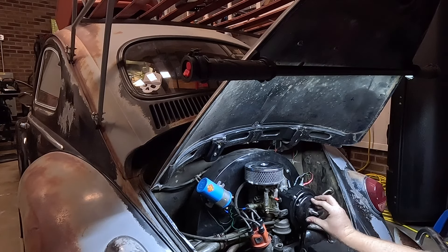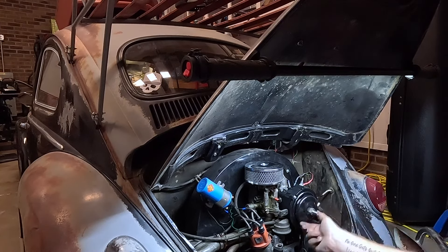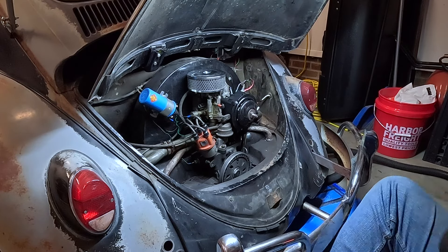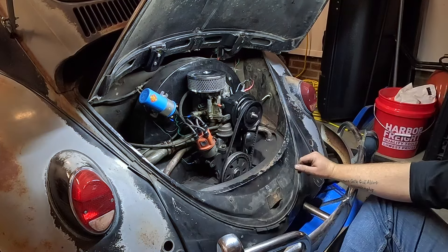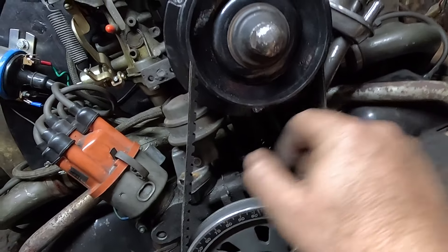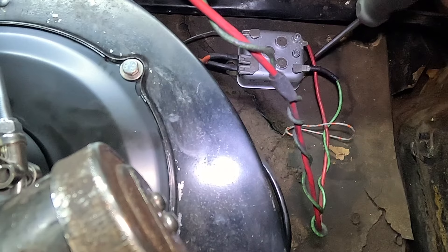The biggest part is installing the pulley — push it in all the way, spin it, make sure you're not hitting anything. There are a total of 10 shims, and I'm going to do the same setup that was there — right now I think it's seven in here and then three on the outside. Put the belt on and take the other shims. You're supposed to have about an inch of play on both sides of the pulley.